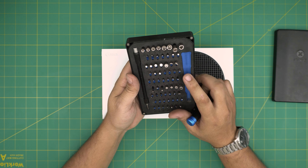And that's how you replace or remove the storage on your Xbox Series S console. Follow the link in the video description if you want to know how to install the operating system — it's very easy. You'll need a USB drive with at least 8 to 16 gigabytes of storage. To put the bottom cover back on, bring it down in an offset position, slide it in, and put the last two screws on top. I hope this video helped — feel free to leave questions or requests in the comments. Thanks for watching, and I hope to see you in my next video.